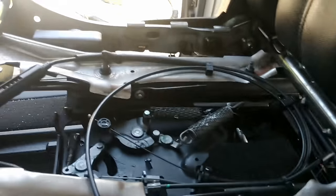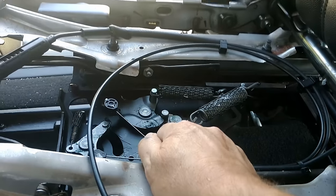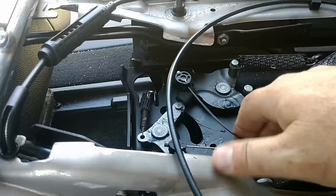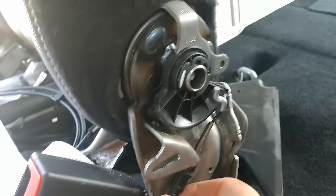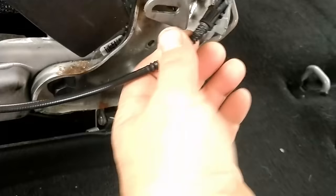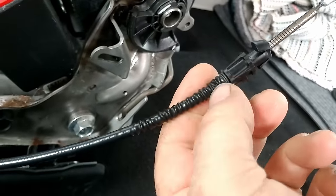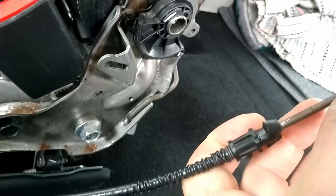The way the mechanism works, as this seat comes down, it triggers this lever right here. Now, this lever is also hooked to this one right here. So when this pulls down, it's supposed to trigger this and then release the doors. The problem is this cable sits right in here, and it's supposed to hook in this. So when you fold that seat, the cable gets pulled and stretched. You can see here what the deal is — see how all that is kind of pushed up? This part of the cable has pushed through this. This black plastic is supposed to be way up here.